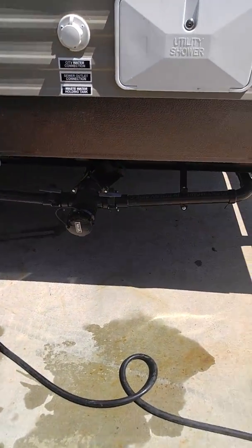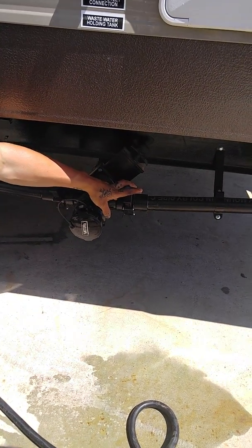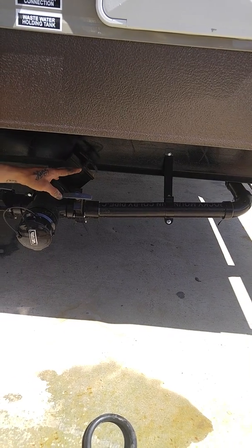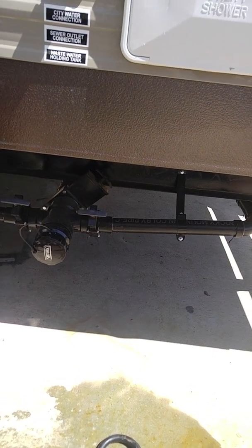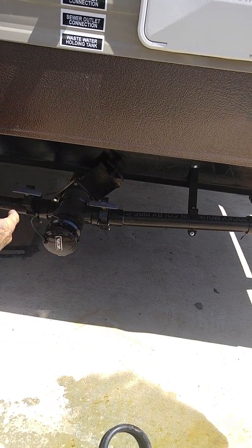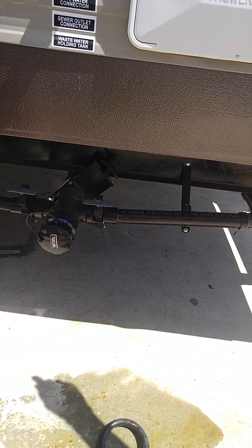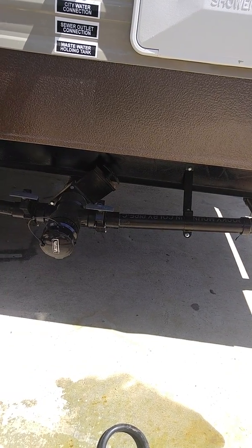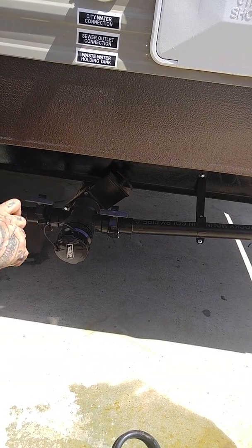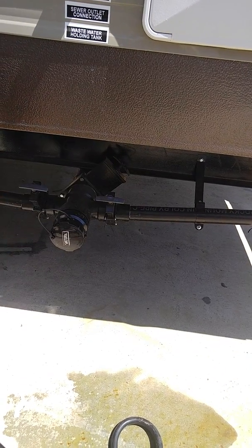This is your gray tank here, and this is your galley water — also your gray tank. You want to flush your black before your gray. Because if you do your gray before your black, you're still going to have that waste residue in the lines. You do your black and then your gray. Once you do your black, you could connect that water to come out through the whole process of dumping — it's spraying out your lines, you dump it, and then you let your gray go.